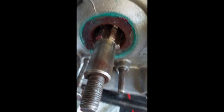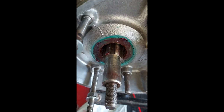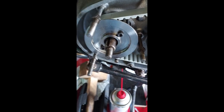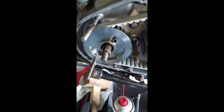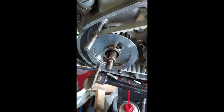I put some red rubber grease round the lead-in for the front pulley, and that's the new oil seal back in. I put some red rubber grease around there to help the lead-in from the pulley slip underneath into the oil seal. That's the front pulley back on again, with a little bit of thread locker on the back of these Allen screws to keep them in place. Hopefully it won't have to come off again.